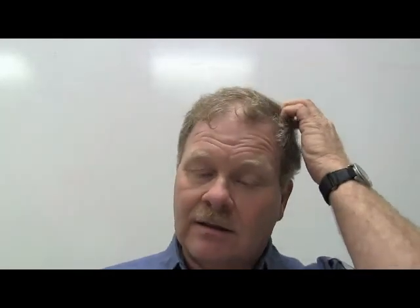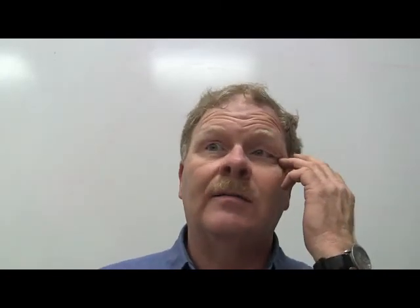All right. So, you know what my old rule of thumb is, and I never heard anybody else teach this: the part that's in the most hostile environment and working the hardest is the part that usually fails. That's usually where I focus my diagnosis, unless it's really, really hard to get to. So, what's in the most hostile environment in your fuel gauge indicator system? The doggone sending unit is sloshing around in that tank with all that gasoline and everything in it, and it's always moving. Up and down.